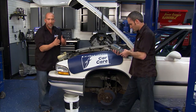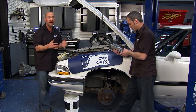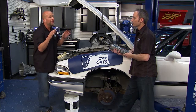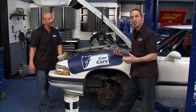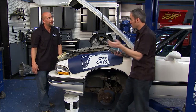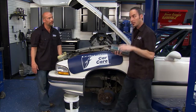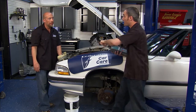To increase and decrease line pressure really rapidly — sometimes 40, 50 times a second — because it knows a car can't go from 70 to zero in a second. It can, you just probably don't want to be in it when it does. Now, it's really important for brake safety, but it's even more important for steering. Because if you lock up your wheels and try to turn, the car will just keep going straight. But with ABS, even though you've got that sort of shaking feeling, you can full hammer that brake pedal and still steer out of a bad situation.